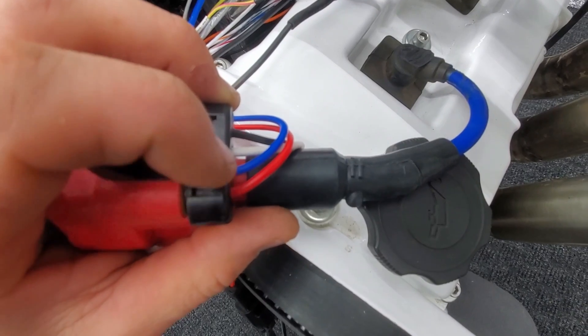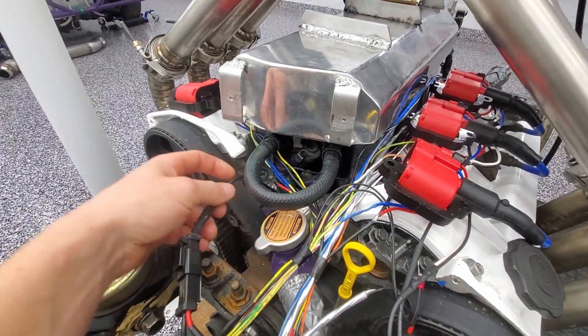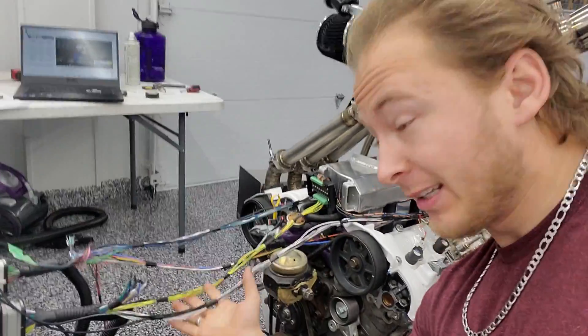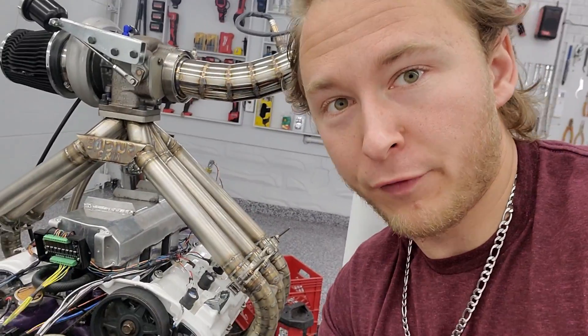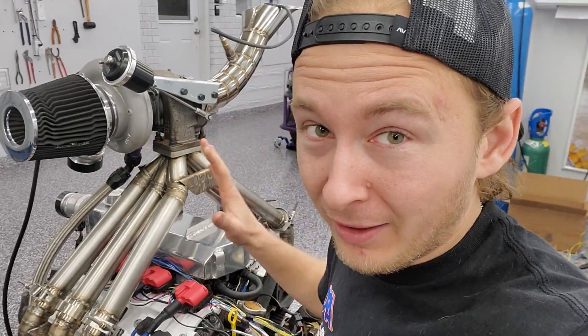It is not too bad, but it's better to make sure — it took me a long time to figure out exactly how to do it. I mounted all of my grounds to the block. Red is 12 volt, blue is the signal from the ECU, and white and black are grounded to the engine. I did some research and that was what was recommended. From the factory, the LSs are wired one to the ECU ground and one to the engine block ground — that works for stock, but apparently it's better to be engine grounded. Everybody's been having no issues like that, so I'm going with it. Like, comment, subscribe and we'll see you in the next one.